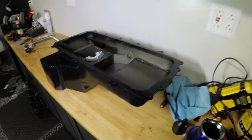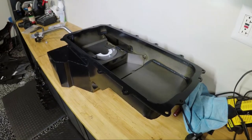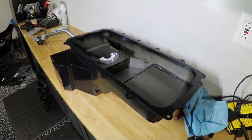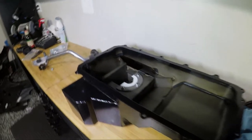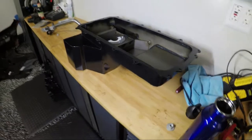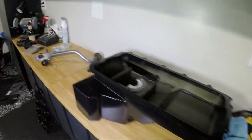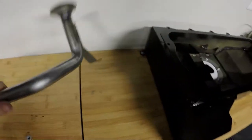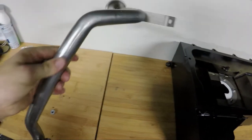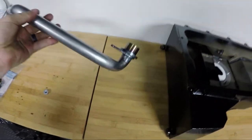I'm very excited to put this on. It was always the plan, but I prioritized it because I'm apparently leaking from the oil pan I put on — either a bad seal, a crack, or something. So I'm putting this on now to fix that oil leak. This is the pickup for it, and it's unique to the 5.2 — specifically the 5.2 oil pump.